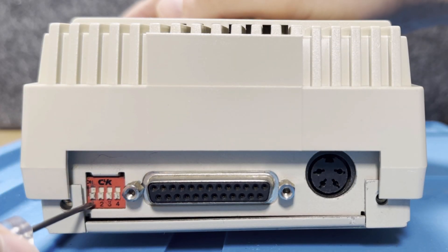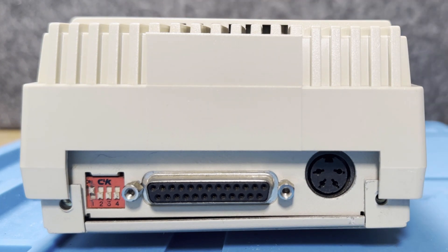I'm going to set the first dip switch on the back of the A590 to enable autoboot and see what happens. Well, it seems to be freezing at this point. Just in case it was waiting for something or needed to wait to time out I left this for several minutes. There was no activity on the hard disk light either. So I'm going to switch the dip switch back off again and try booting the A590 setup disk.